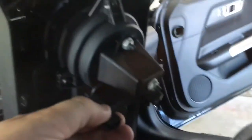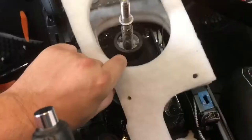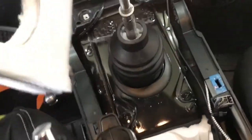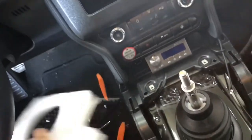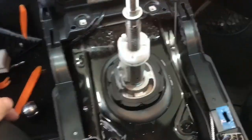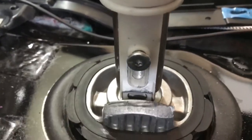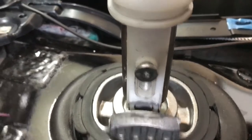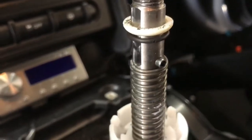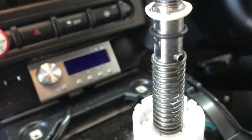If it was a premium model, you'd also have the MyColor wire for the cup holder lighting to disconnect. Next, take off this heat shield — pretty sorry heat shield Ford uses. Then take out this rubber piece. For this particular kit, you're going to disassemble the reverse lockout — take this Torx bit loose, drive the pin out, and pull the O-ring, isolator, and spring off, then pull it out from the bottom.